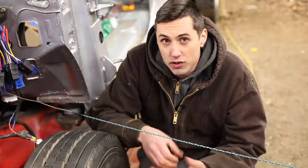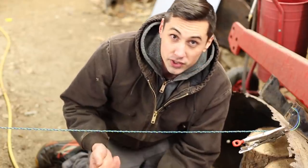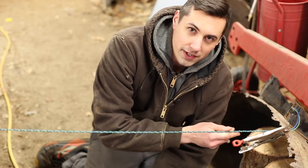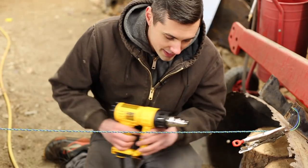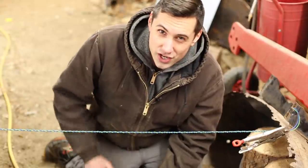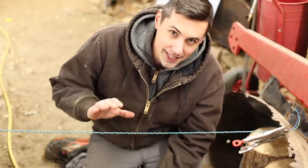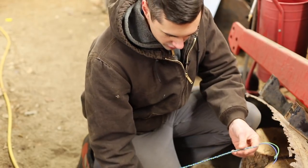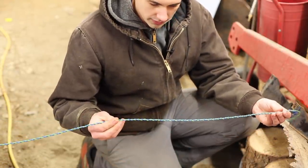I want to take a moment to talk about twisted pairs of wires. This wire goes to the vehicle speed sensor on the transmission, and the original wire wasn't long enough to reach, so I had to extend it. When you extend a twisted pair, make sure the new wires are also twisted in the same direction as the original. These wires are twisted because it greatly reduces sensitivity to electromagnetic interference. The speed sensor is an inductive type that sends a very precise sine wave — any electromagnetic interference could ruin the speed signal. To make this twisted pair, I twisted it by hand, clamped it to hold it taut, then used a heat gun to slightly melt the insulation so it would stay in position once cooled. Yeah, that's not too bad — this is totally usable.